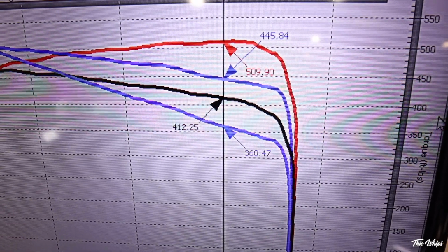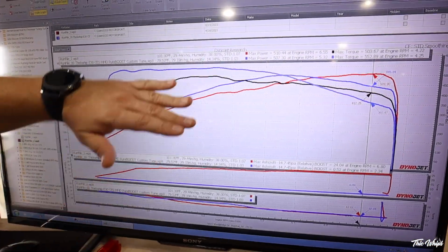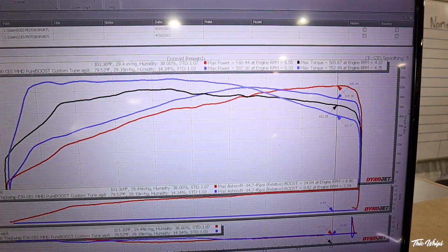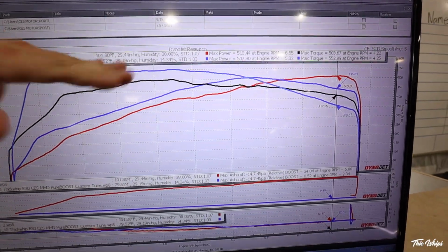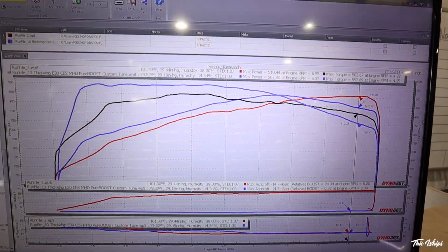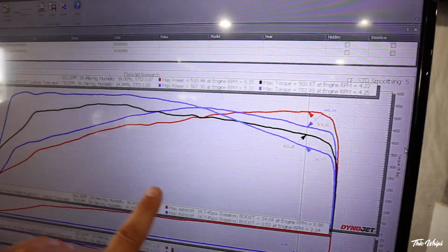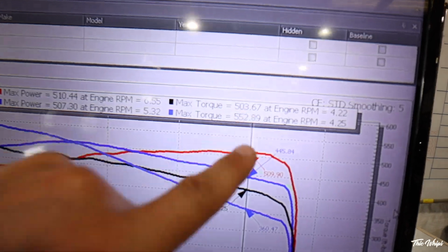So once you do E50 with the PURE 800, you should be able to pick up this torque and then some, plus also raise the top end, which again will outdo the stock turbo by a good margin. Yeah, so the E50 is gonna be the ticket with the PURE 800. That's really gonna allow us to make up where we lose some of this torque.